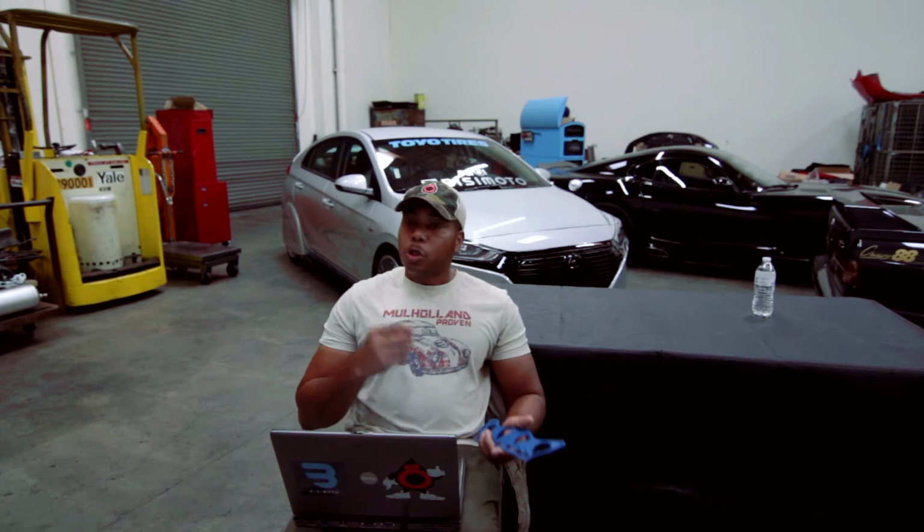As I mentioned in the previous talks, internal combustion engines are just glorified exchangers of energy. They allow you to take chemical energy, create heat, and then create mechanical energy. And one way of making power is by having as dense a mixture of oxygen-rich molecules as possible in a given ingestion of air, combusting that with the appropriate amount of fuel and creating heat. So one cool way of doing that is by isolating the heat of the engine from the intake, because the intake manifold has a great duty of allowing air to enter into the engine. It is the atmosphere that feeds the power plant. And the cooler you can have that air come into your engine, the more power you can make.